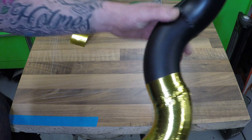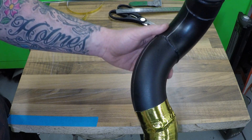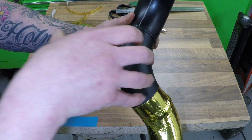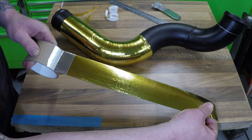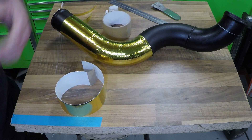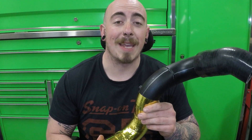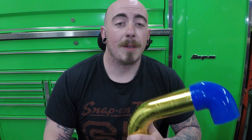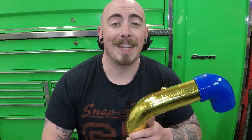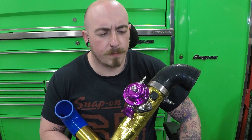Looking pretty good on that bend. Now we're going to start working on the bit you can see from the engine bay, so I've drawn an imaginary line on the outside of this bend so that all our overlaps are around the back and won't be seen. Well, I ran out of tape, which sucks. A little bit of advice: if you are wrapping your intercooler pipe or your headers, order more than you think, because with the overlap the tape does require a lot more than you'd expect. That is pretty much the intercooler piping done, so hang around for the next episode — don't forget to like and subscribe. Have I gone too ricer?